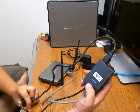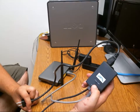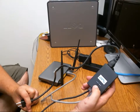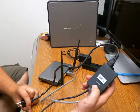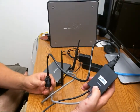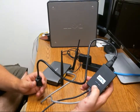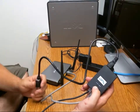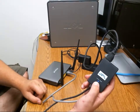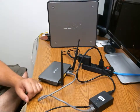Same idea — we're going to unplug it from the power strip and wait for that little blue light to go out. There it goes. Generally 15 to 20 seconds is just fine. If you don't find that restores your connectivity, try it for a little bit longer — I've had instances where 30 seconds wasn't enough, but waiting a full minute worked. Now we'll go ahead and plug it back in — blue light's back on.